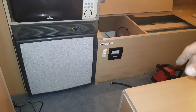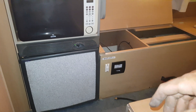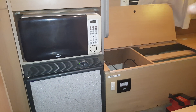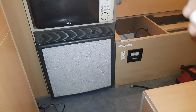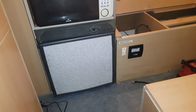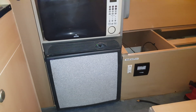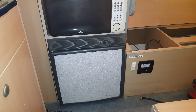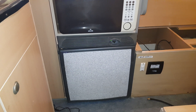There's also an AC charger for this one in there - that's only a 10 amp thing, barely going to keep up with the lights to be honest, let alone the fridge. But when you've got AC connected, the fridge runs on 240 and 12 volt. I only noticed this because I unplugged the lead the other day - the fridge skipped a bit and then kept going, which is just a relay inside the fridge changing over. So if you've got AC or grid power you can run it off that, or if you've got a dead battery but a genset, you can run it all off that and charge your battery at the same time.